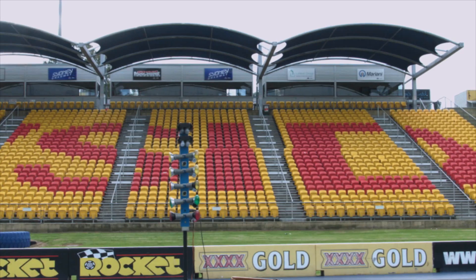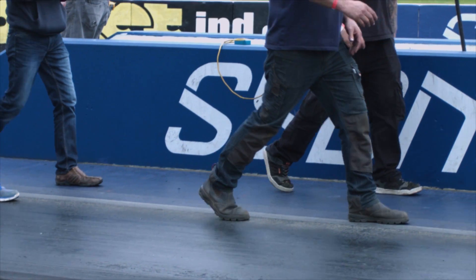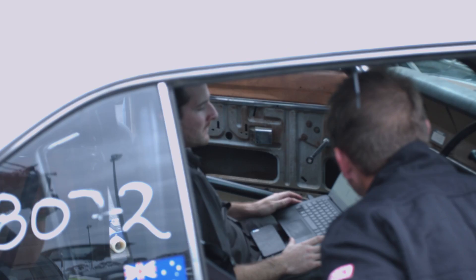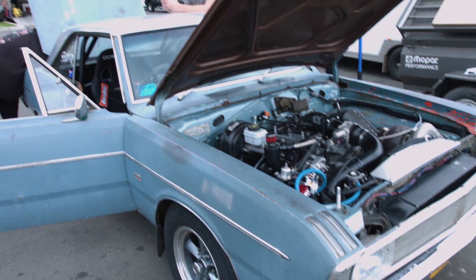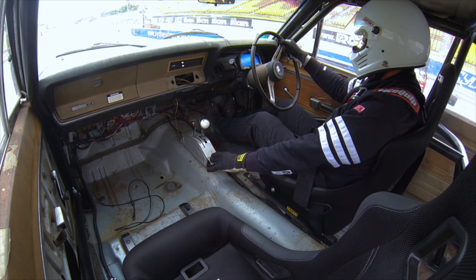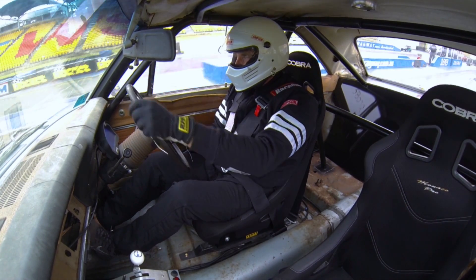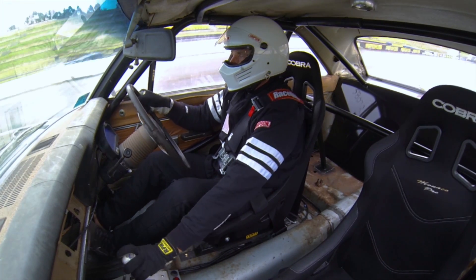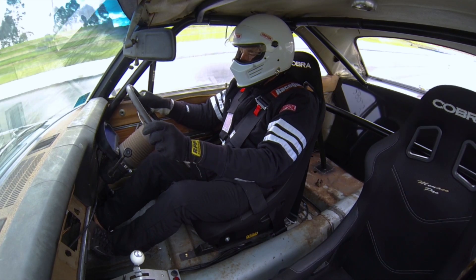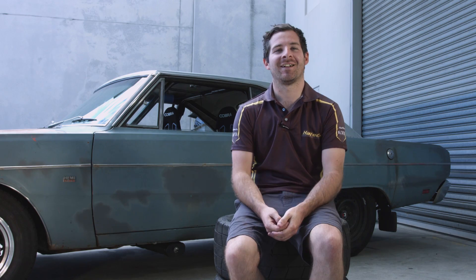With the cooling and brake system back under control, the guys were eager to take the car to the racetrack for a couple of shakedown runs. The first shakedown run revealed a few problems, preventing the car from running smoothly and quickly. The first problem was with boost — our boost control was just not working properly. During the first test pass, we noticed that the boost was just not where it was programmed to be. We opened the wastegates and the springs weren't matching, and that's no good.